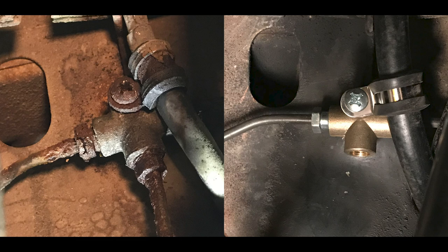I got pads and all the normal wear and tear pieces for the brakes. As soon as I started taking things apart, I realized just how deteriorated most of the stuff was. The cylinders were leaking, the backing plate was completely rusted through, and the springs were not attached to anything. I was going to change the flexible brake lines, and then as I examined the system, all of the hard lines were really rusted as well.